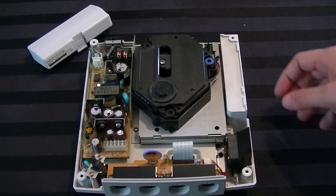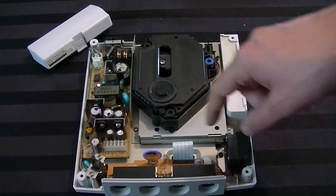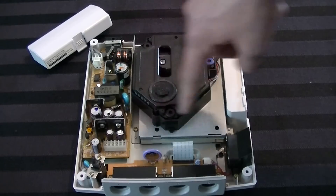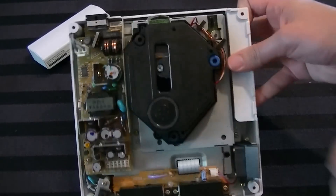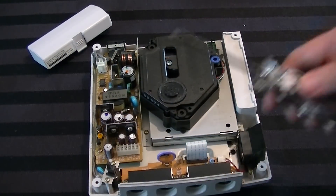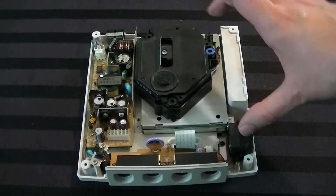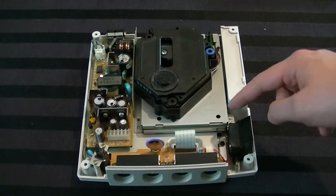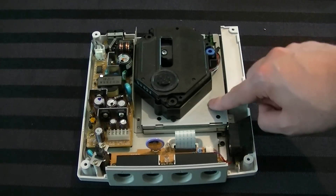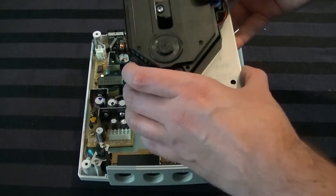Take the modem off by applying a little bit of pressure. It will reveal one screw point — there are four in total. It just uses a standard Phillips head screwdriver. Once you have your screws out, you're going to flip the console over like this and just lift the top off. It's incredibly simple, and you'll see the inside of the Dreamcast — not a particularly complicated machine. So what you have to do at this point is remove three extra screws. Once you have your screws out, we're going to remove the GD assembly. The only source of pressure will be right about here — there's a connection point. You just kind of lift up and out it comes. No big deal.